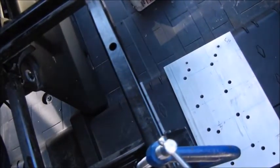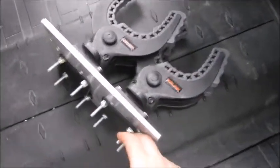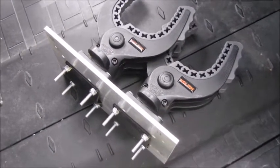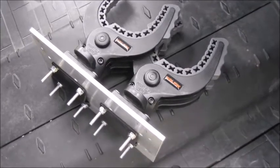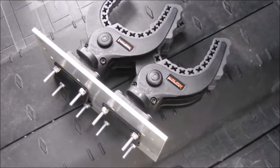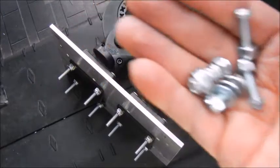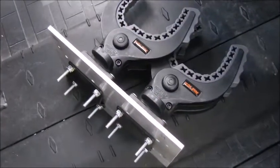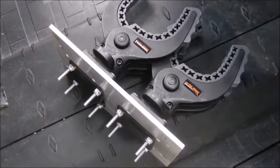I'm going to get these grips mounted. I've got everything tightened up. These are the bolts and lock nuts that came with the grips — they are a little long, but they're lock nuts so why not use them? There's going to be plenty of room for the extra thread under the seat. I did have to purchase four bolts from my local hardware store to hold the plate to the seat frame. You can go to your hardware store and find something that fits — these perfectly fit through the 3/16-inch hole drilled to go through the seat frame.